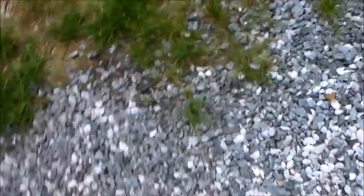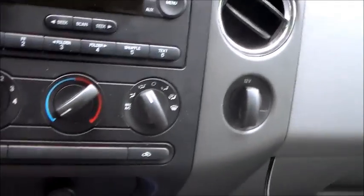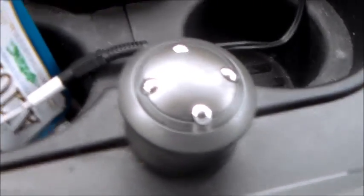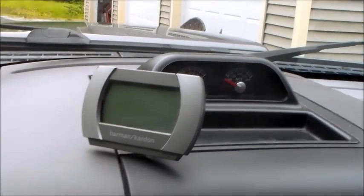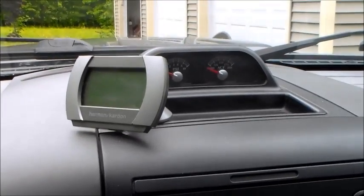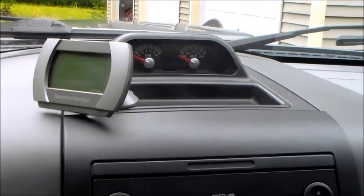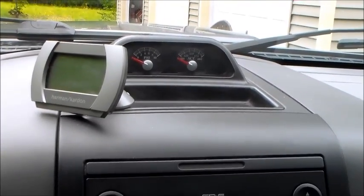I also wired up an aux port on my old daily driver, a 2006 F-150, for my son. I had the old Harman Kardon drive and play with the 30-pin connector, and I already had a Precision Interface Electronics adapter wired in. I just had to open it back up and wire in the aux cable. We bought a 30-pin to Lightning plug adapter, but it did not work. So now he's rocking in style and doesn't have to use the little speaker he's been using in the console.